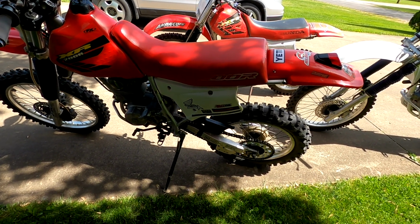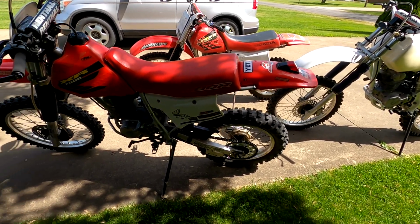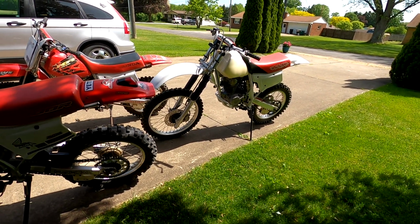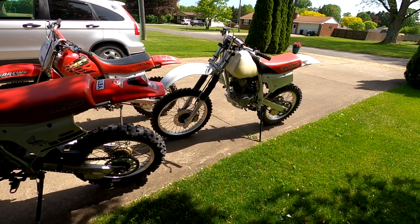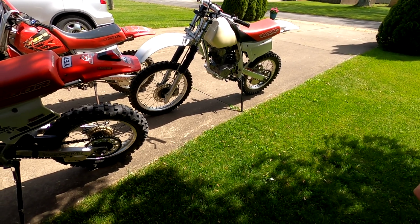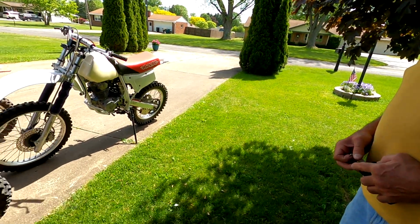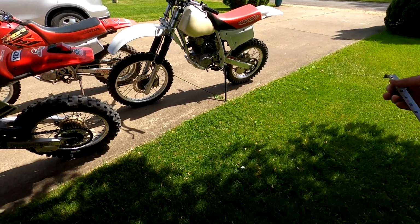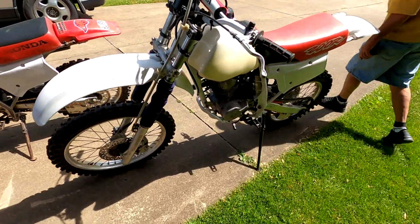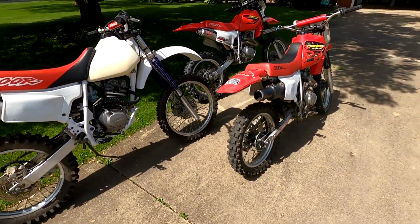Between these bikes, if I was going to ride the trail, which would be the most fun? I obviously love my bike because it's really cool, but I think this one with the disc brakes would be pretty awesome too. Runs nice, starts nice. I can't say enough about that Niche carburetor. If you just swap the jets, I don't see any reason to rebuild a carb again. For 20 bucks, you save yourself a lot of hassle just swapping some stock jets in. The stock jets work perfectly, and as soon as you change them, it runs perfect.